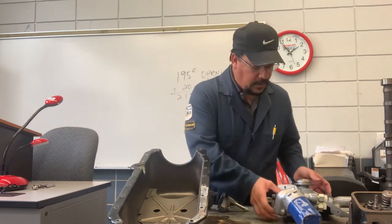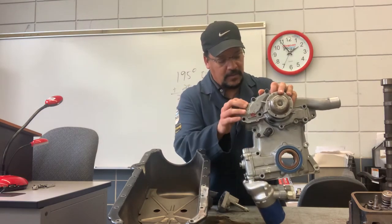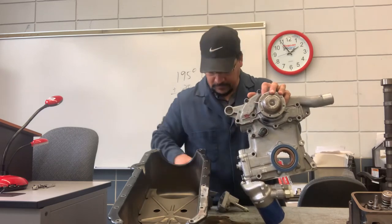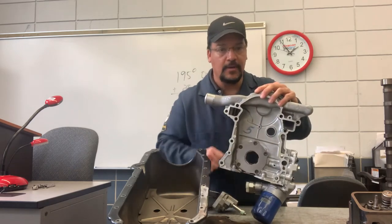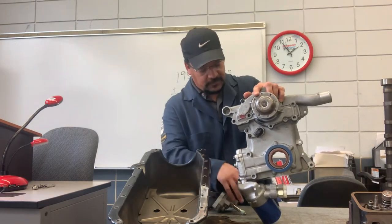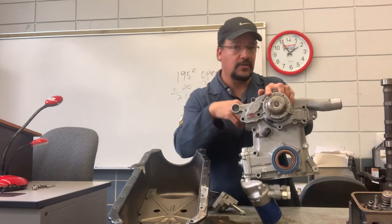You see this type of oil pump, and the other one I was telling you about — also incorporated within the timing chain cover — is a rotary type. This one's got vanes and rotors on it. When you get the oil pump assembly, this whole assembly you have to purchase. You've got vanes and rotors in the back of the pump right there. Your PRV valve is inside here. And of course there's your oil filter — after it filters out, it goes over to your main bearing galleries all the way up to the top part of the valve train, and then of course it gets splash fed back down to the drain backs.